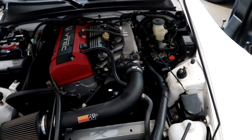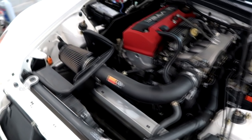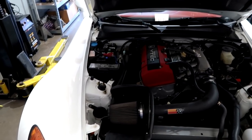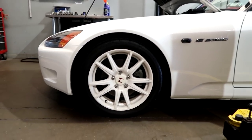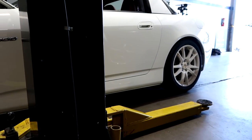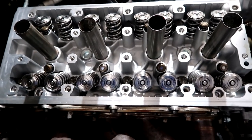Engine, trans, diff, brake fluid flush, clutch flush, new serpentine belt, full inspection — everything is good. Just got to torque the wheels, double-check the clutch adjustment, and we're good to go. Customer is all clear, ready to come back later in the year for a package. One mental note to keep: the height difference — there's your front and there's your back. Classic case of front on the back, back on the front.